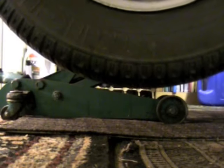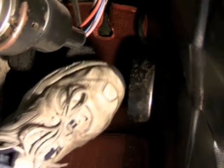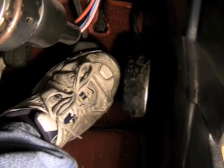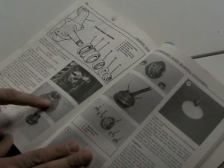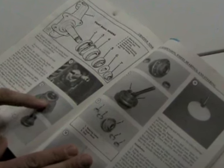Release and remove your jack stands from underneath the car, lower it down, and remove your chocks. Re-torque your lug bolts once the car is on the ground. Don't move the car without first pumping the brake pedal several times to reset the pads. This was just a fast overview — take your time and follow your shop manual.